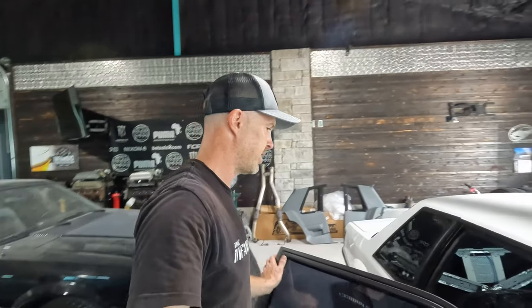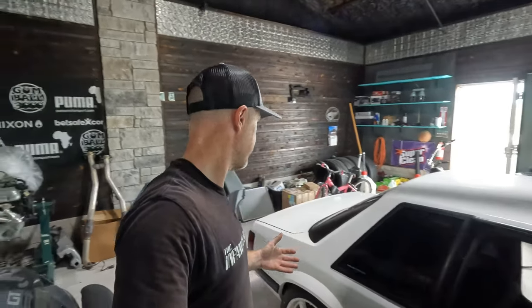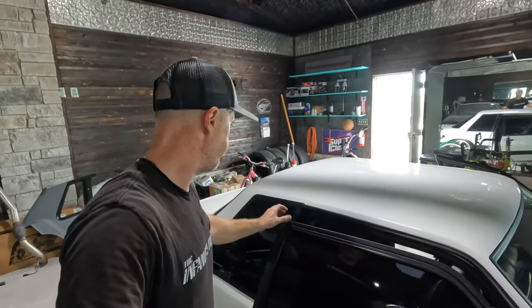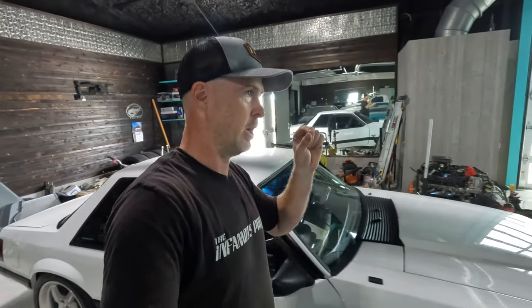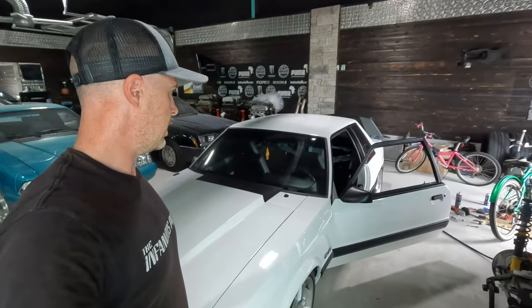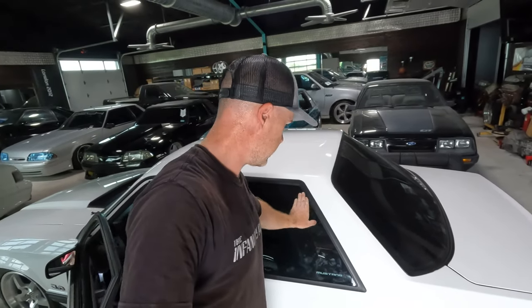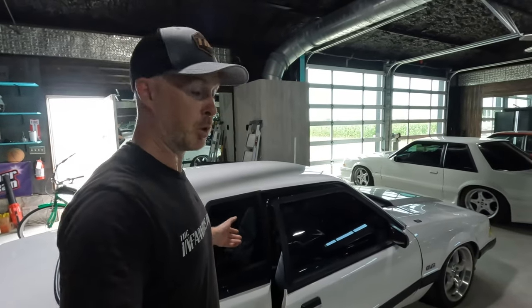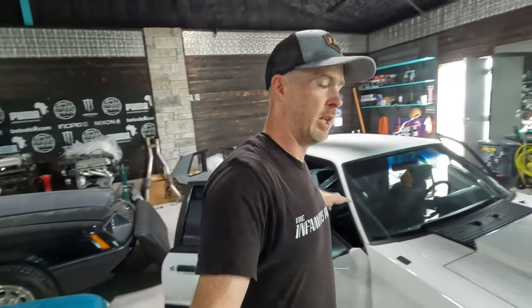I got both quarter glass in and did the light test. If you really want to be thorough, get a bottle of water, pour it over your molding, and see if water comes inside the car — because you don't want to put all your rear plastics back in just to find out you have leaks and have to pull everything out again. Everything went in nicely. I kept my eye on the rubber at the stud area while tightening, went around in a circular motion until everything felt snug. Once it feels good, don't overdo it or you'll just make more work for yourself.